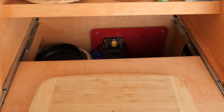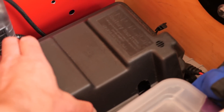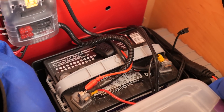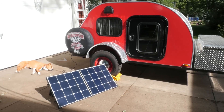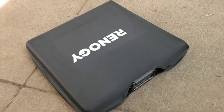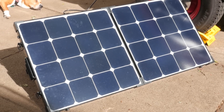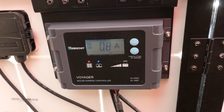In the trailer, I have a 12-volt U1-sized AGM battery with 33 amp hours of power capacity. I can charge it either with an onboard battery charger — I'm using the Noco Genius G3500, a 3.5-amp charger — or with a 100-watt solar panel. I have a Renogy Eclipse solar suitcase. We almost exclusively dry camp with the trailer, so the Eclipse has been a great addition to extend the length of our outings without needing electricity. I can run a power cable off the battery located in the galley to power my equipment.